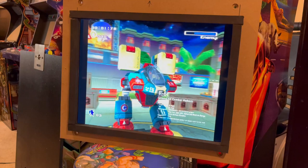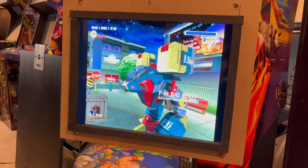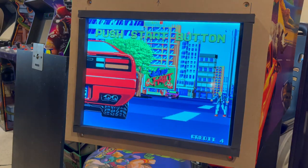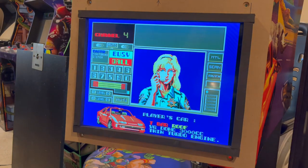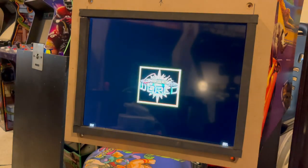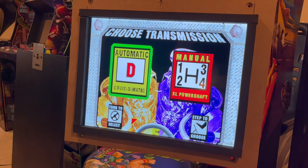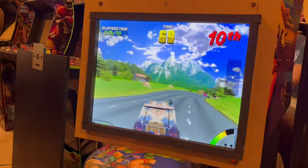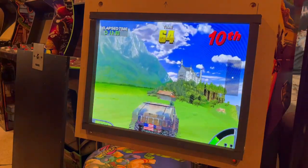My results were at best mixed. When I plugged in my Dreamcast with a VGA cable, the image top and bottom fit fine but black bars appeared left and right — a little weird. I also have another arcade cabinet, my SCI cabinet, with an LCD modification and a VGA cable. I plugged that into the back of the monitor and the image actually fit. At that point I decided to go back to a CGA connector on the Midway cabinet and use the CGA input on the Unico monitor. When I did that, the image fitment was exactly the same but the image quality was just so much worse, so it was definitely better to use VGA. Going back to VGA gave a nice clean crisp image, but the placement on the monitor still just didn't quite fit — really frustrating.